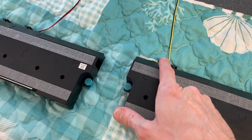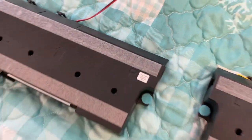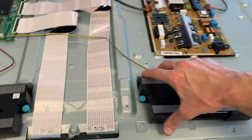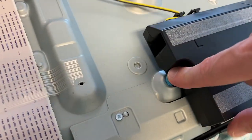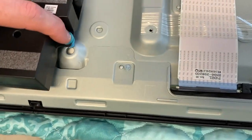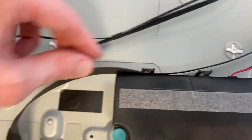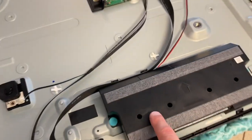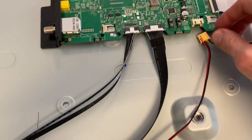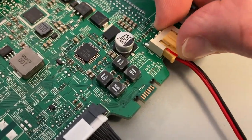Once you open up the new speakers, the yellow and black wire is on the left speaker; red and black is on the right-hand speaker. There are your part numbers. Go ahead and rest these in place — the left-hand side will basically be on your right-hand side as you're installing it. Align those rubber grommets in their holes and push until they are secured. Grab that wiring that feeds out of your Wi-Fi module — there are two tabs on that speaker that the wiring snaps into place. Then re-secure your connection point into the main board, being very careful. Push until you hear it click.